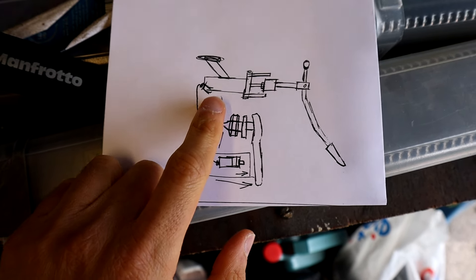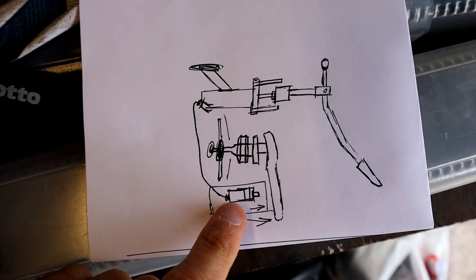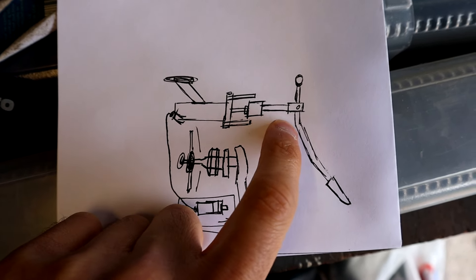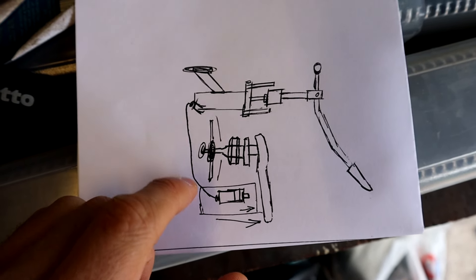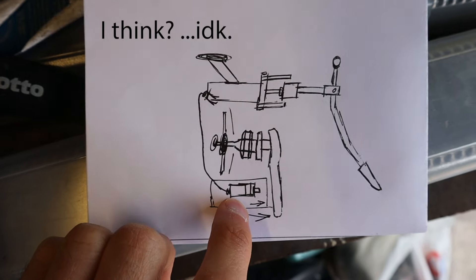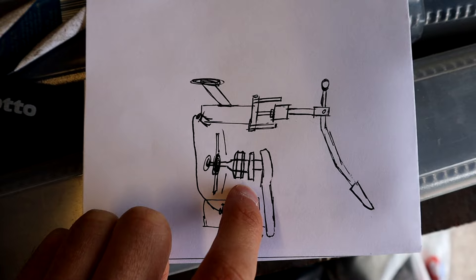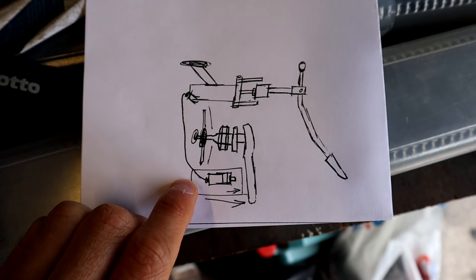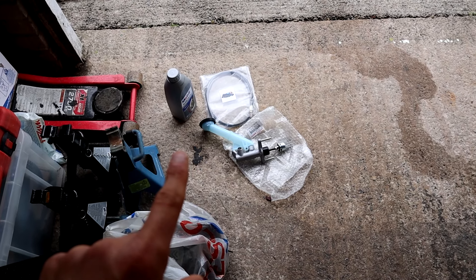As you can see, I've drawn this little diagram — there's the clutch fork, slave, master and clutch pedal. This is a different length, the cylinder is a different size and a different length, the travel is all different. The pressure will be different going to the slave, which alters the way the clutch works inside the car — alters the way the fork makes contact with everything. So this is the issue I'm having, and we're going to try and solve it by installing what I think is a smaller cylinder with more travel — but don't quote me on that.